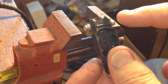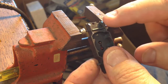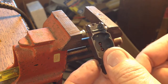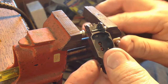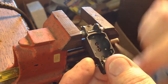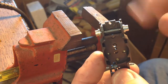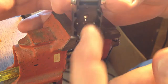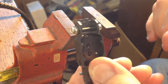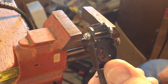Hey, just real quick, I just put the hubs on. They're barely on the axle. I put them on just with my fingers. But this is a great way to get the hubs on, and you know they're going to be straight. You see how I'm lining this hub up with the corner here? I'm going to be lining that one up with the corner here, but I'm kind of pushing it to the right a little bit. And then it just straightens out. But what's interesting is if you tighten it all the way to where you feel that the hub is on the end of the axle, you can tell by tightening it that is the perfect amount, and it should swing freely. That's what normal is. We're going to go ahead and oil in there and oil the other side of the axle. But just real quick, that's the easiest way to get the hubs on, and you know they're going to be put on as straight as your bench vise is going to be.